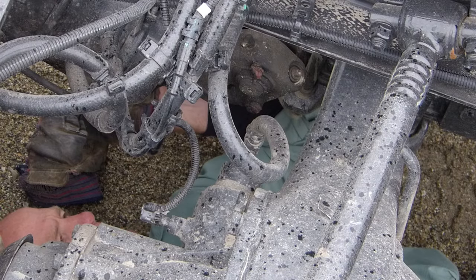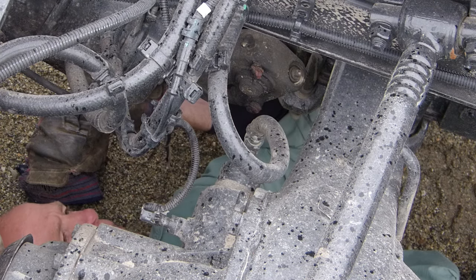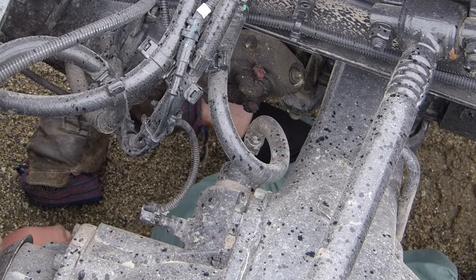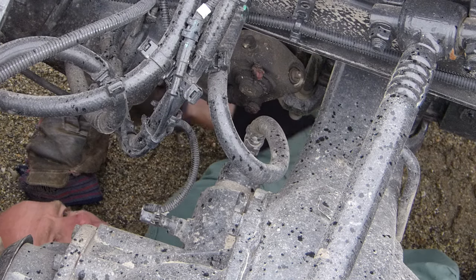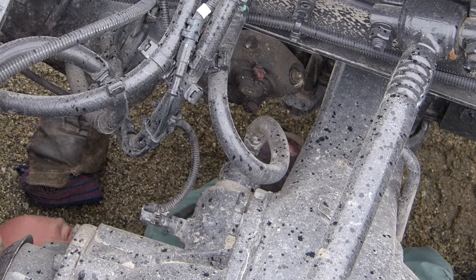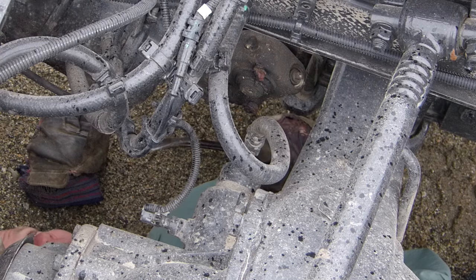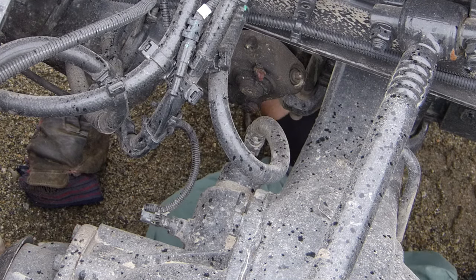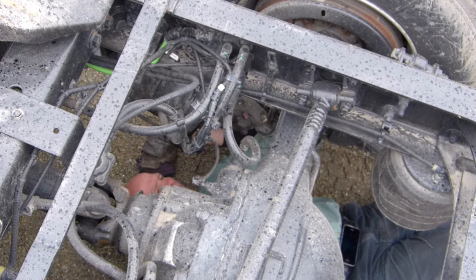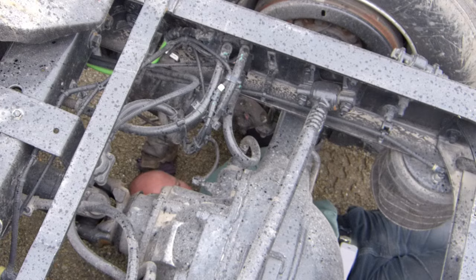Underneath the truck we're doing the pry bar method to check push rod travel to ensure that it's within limits. We pull that out and we can see the yellow marker is coming out — essentially not even the width of my thumbnail, so it's within half to three quarters, well within the inch in the state of California. You're going to check the brake chambers because with the brakes released and wheels chalked and air inside the chambers, you're listening for air leaks — don't hear any air leaks. Lines, hoses all secure, not damaged. The valves are all secure, not damaged. Essentially put your pry bar on there — slack adjuster comes out half to three quarters — and you're going to do the same on the other three brake chambers underneath the truck.